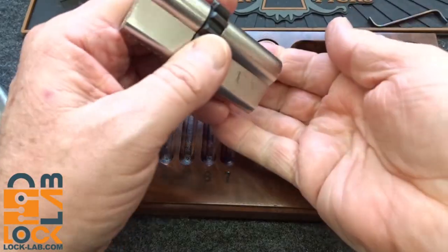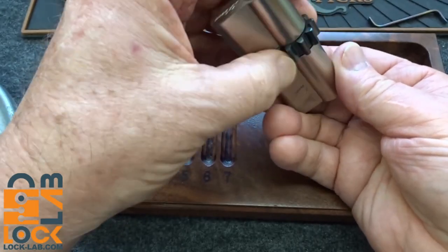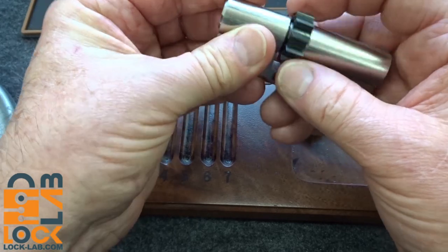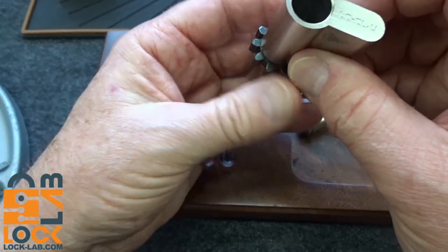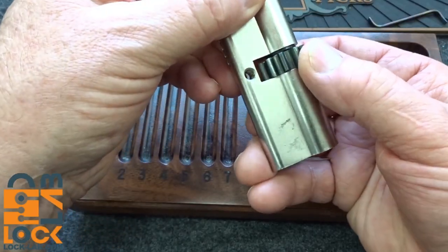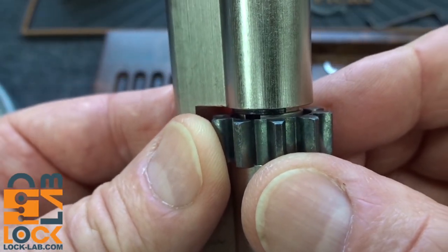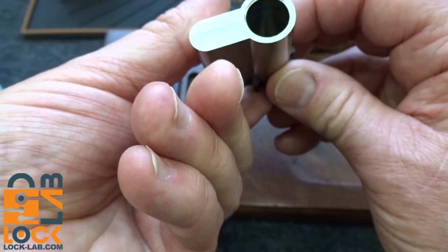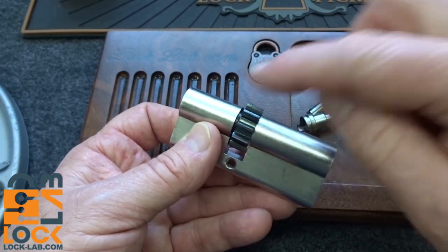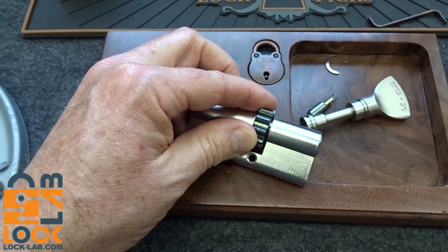All right, before we start losing stuff, there's got to be more in there, because this doesn't. All right, the actuator. Got to be more than that, right? Okay, I can see, not quite as easy as I thought. There's another C-clip on the back of the lock, and then I'll have to start him moving out, take this actuator out, and then fit a follower in there. It's a little more complex than I thought, but I've already committed, right?